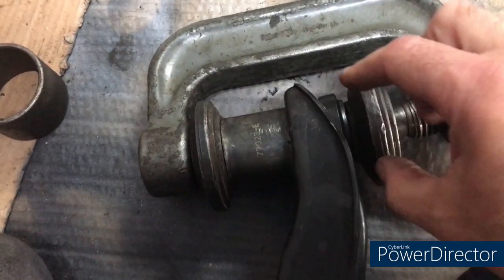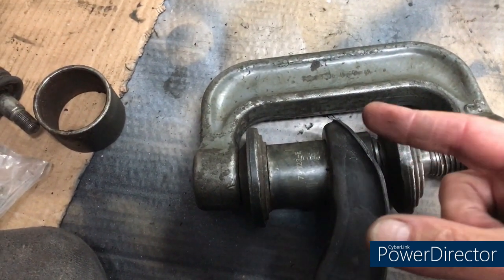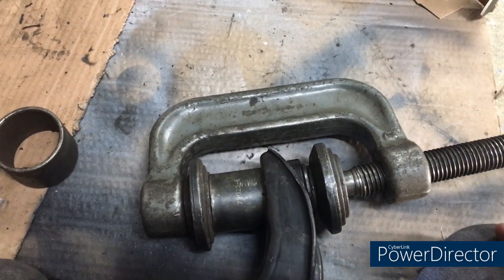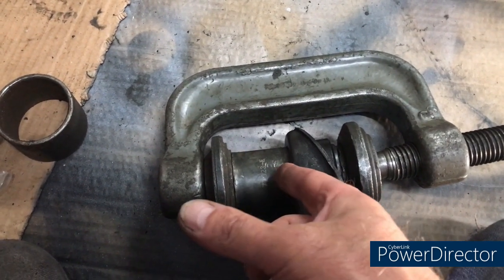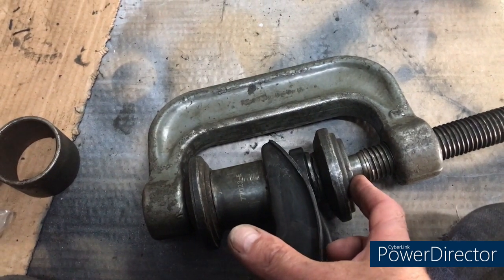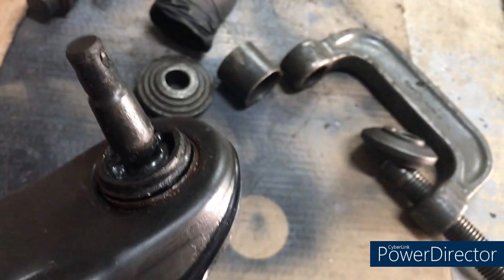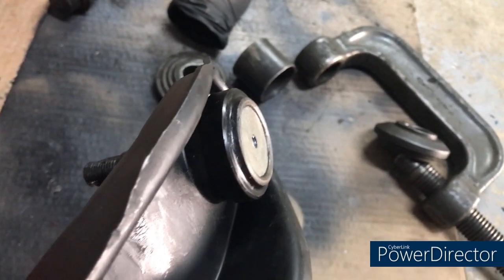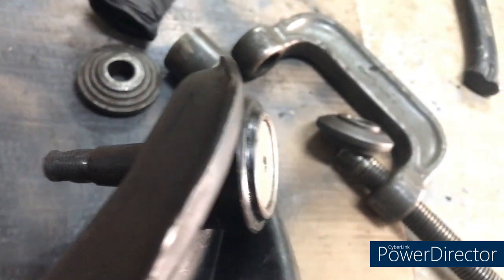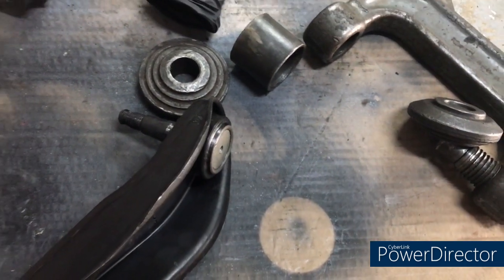I've cleaned everything up and placed the new ball joint in, positioned it as square as I can get it. I put a tiny smear of copper anti-seize around the flange to help putting it in and help prevent corrosion 20 or 30 years from now. There's a sleeve here so the ball joint can push up, a fitting at the top, and one that pushes at the bottom. It is pressing — I had to back it out once because it started going in crooked, then pushed it in again, shifting it to go square. It's in, it's square, it's tight.